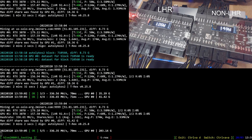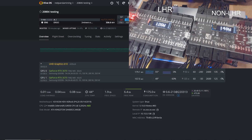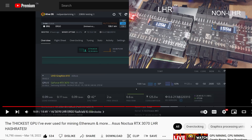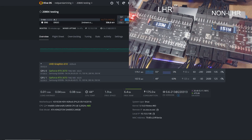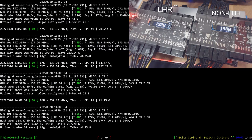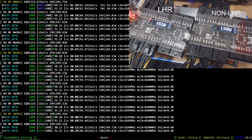In T-Rex miner it's reporting my non-LHR GPU at 50 watts in software, which is wrong. For overclocks I'm using minus 200 core, 2400 memory, 135 PL for the non-LHR, and minus 50 core, 2600 memory, 125 PL for the LHR. My Noctua 3070 at the same 125 PL was using about 126 watts - a little more efficient getting the same megahash. Both cards have Samsung memory.